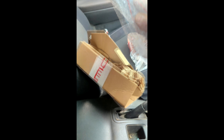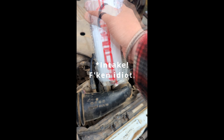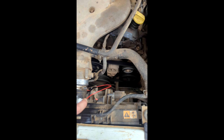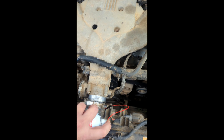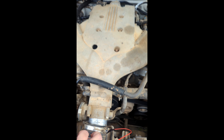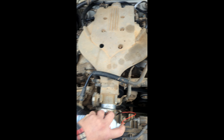So now we've been to town and got our Sea Foam. We've got to take the plastic cover off, shoot this directly into the inlet, and see if we can't get this old Rodeo to smoke. I've got my kid in the car holding the throttle for me and we're squirting this straight into the throttle body. Check the instructions on the can if you get lost.